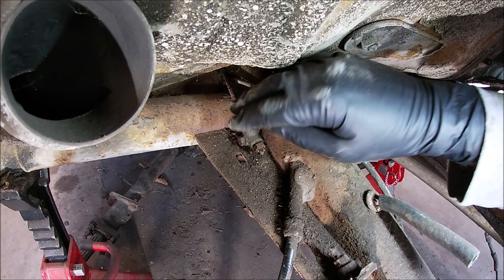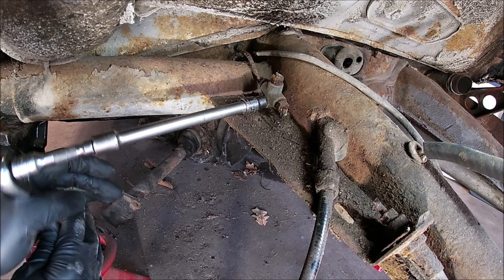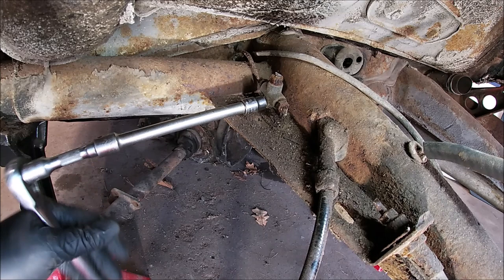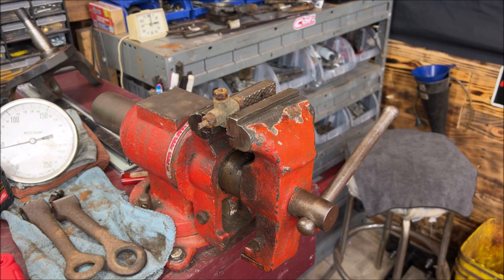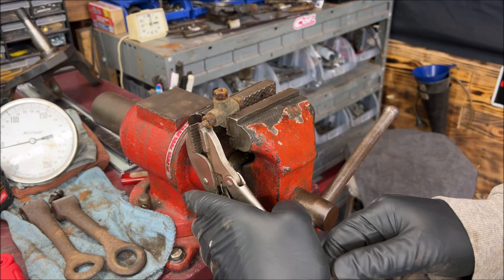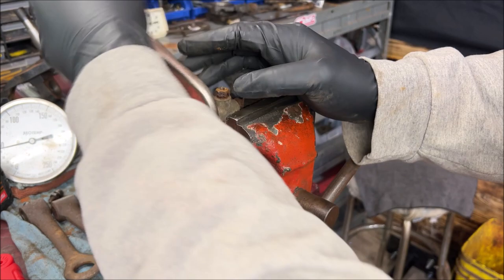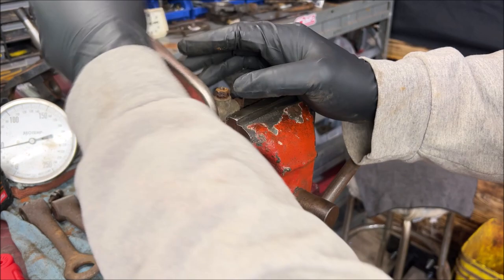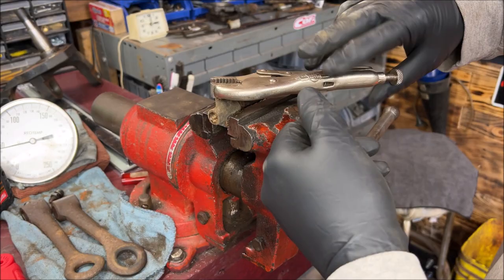Let me grab a 10-millimeter ratchet and get up in here. They do sell replacement fittings, but I like to clean the original German ones up. I'm just using vice grips to get these out of here — I believe it's an 11-millimeter wrench, but these are a mess so I'm just worried about getting them out. I like the original German stuff. It just seems to me the metals were so much better. I'm going to give it a quick wire wheel and show you what this looks like.